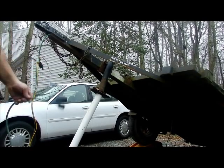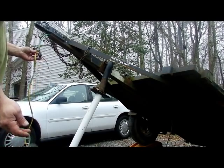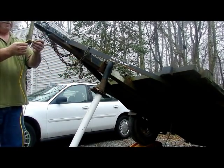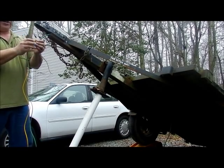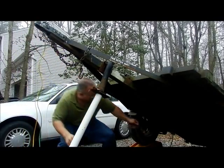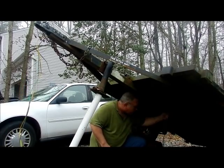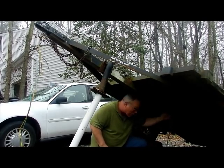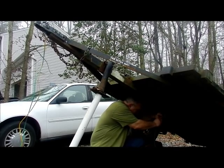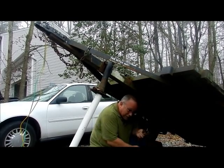What do most of us have in the garage? An extension cord — a single cable that can run down this pipe so we can tie our wire down on it. I already tried a rope with a big wrench on the end and it got stuck halfway. So this will fit all the way through, and if it doesn't come out the other end, you can untie it from inside — you have enough room. We're going to get this over the lip and pull it the rest of the way down. The wires are coming through — mission accomplished. Just work the extension cord out, and it comes out. So your extension cord is out of the way — it did the job, and your wires are here.